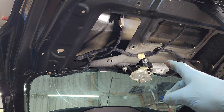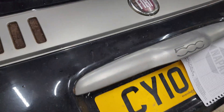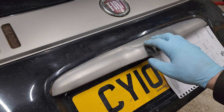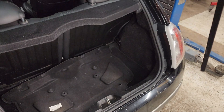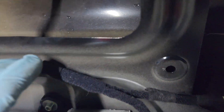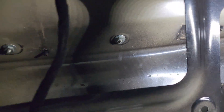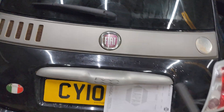The reason these go faulty is because inside this unit here, you've got your wires and connectors, it's all open with nickel copper connectors. There's no waterproofing. Water literally runs through the inside of this boot - this one's actually been outside and it's been wet and it's got water in it. Water does just pull through the back of this. It's relatively well sealed with only holes for the bolts, but there's no sealing on it, so water does run through here. It doesn't matter what you do - water will run through it. It's just an age thing; they just get ruined over time.